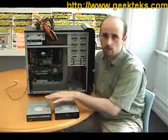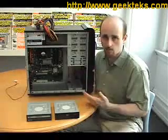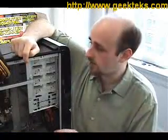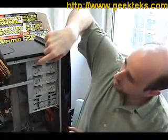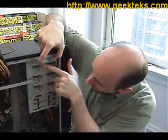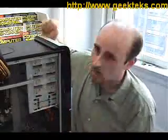These are the two optical drives we chose: a 20X Philips DVD burner and a 16X LiteOn DVD ROM drive. It's great to have two drives so that you can copy disks, but for the most part we'll probably want to use the burner as our primary drive. The case also has tool-less mechanisms for connecting the optical drives, though this can be a little bit tricky. You'll see the plastic restraints here — you need to push in on them and lift up this plastic plate so that you can see the screw hole in there. That'll be very important when we put the optical drives in.